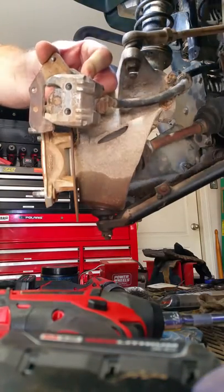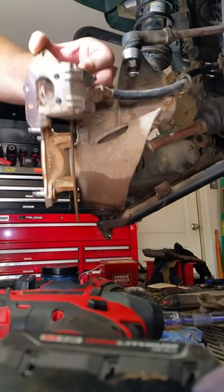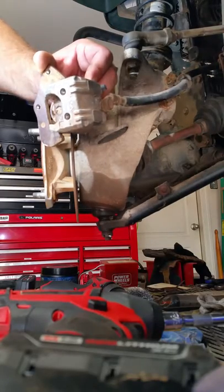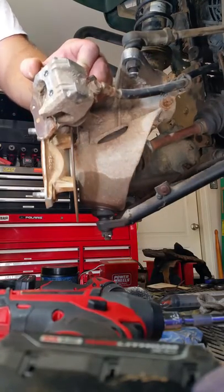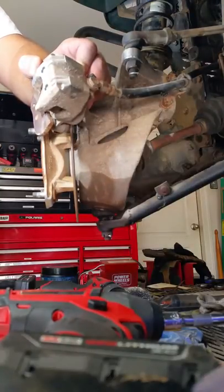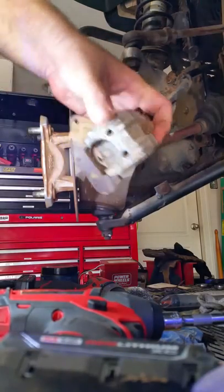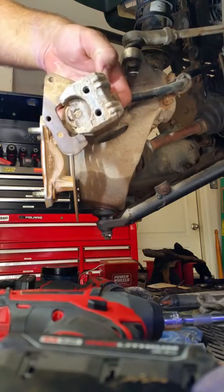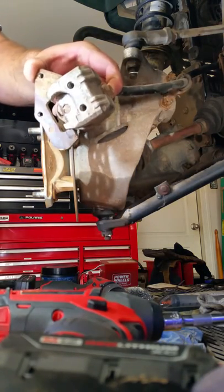There's no pad left in there at all. I'm going to do a little bit of work on this thing. A quick tip for these bikes: the brake pads on the front are both the same, so you don't have to buy a front left and a front right. A lot of ATVs and side-by-sides out there have different pads, so be careful. When you buy them, just make a mark on them so you know where they go and don't have to look up part numbers. I've got to get that pad out of there, clean everything up, and I'm going to rebuild these calipers in another video. I hope this helps some of y'all out — feel free to like, subscribe, comment, and share. Thanks a lot.